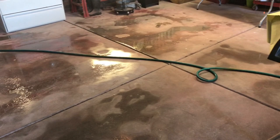Another big tip: I like to keep a water hose in the garage when I'm painting and keep the floor wet. It keeps the dust down — dust won't come up off the floor and float in the air and land on your pieces that you're painting. It works really well. So what we've got to do next is clean these pieces.